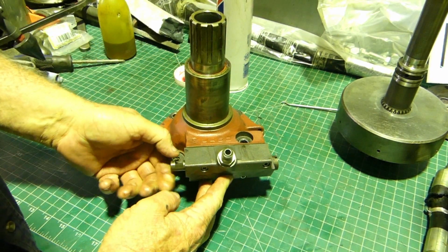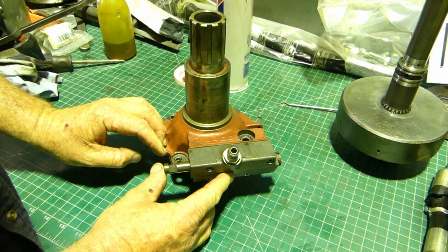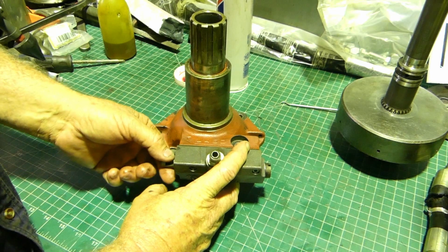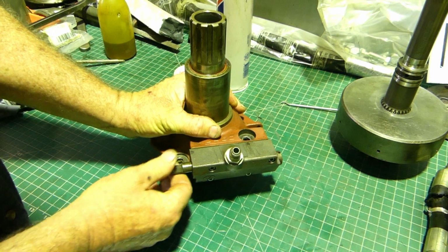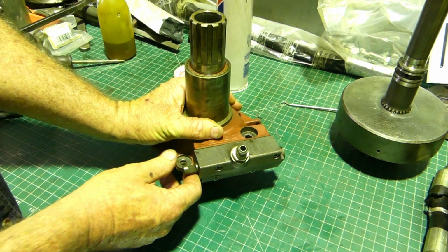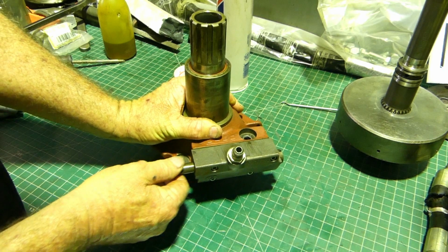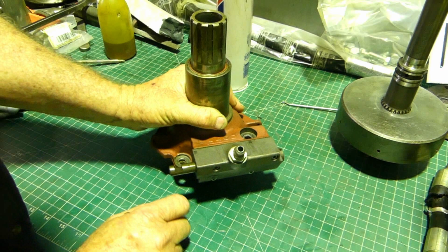It's a control valve. You have a little arm in here, and this just pops in and out and changes where the oil is. Now you'll notice there's no detent there. The detent in a multi-power tractor is often up, it's like an over centre on the dash. So look, that's okay. I know this has had all new seals in it.